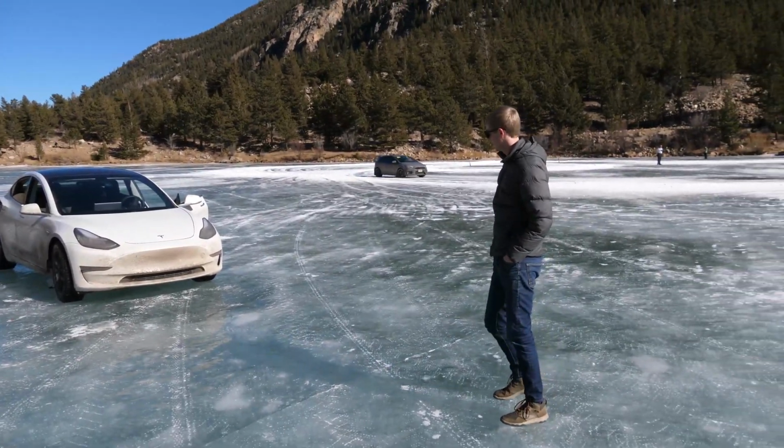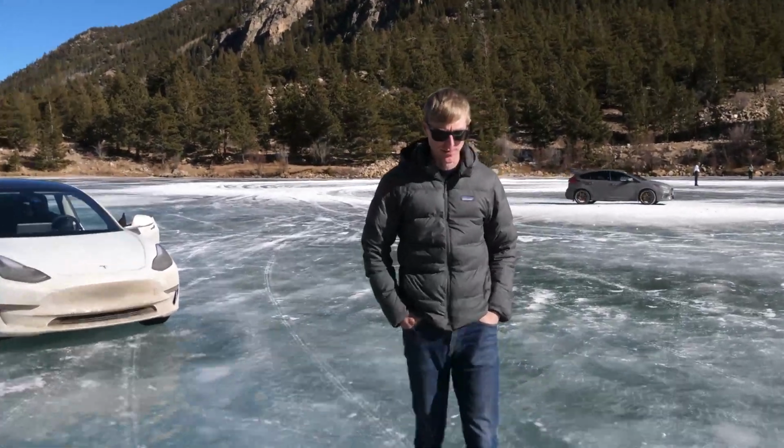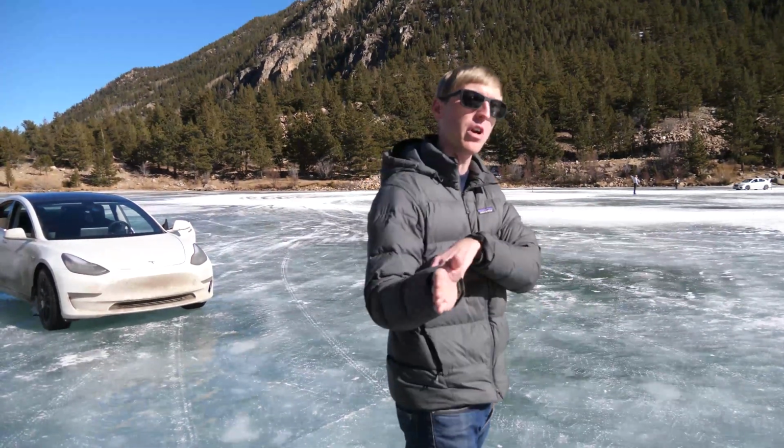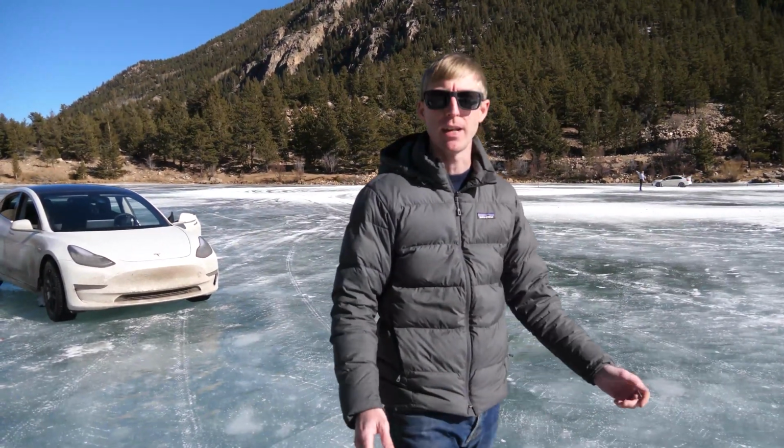All right, that looked like the best run so far, Drew. Yeah, that felt good. What were the settings? So went to 85-15 on the handling balance, which is actually the same thing I like to do for racing on dry pavement. So that's kind of funny to find out. Any further forward than that is too understeery, and any further back you just don't have enough control of the front motor when you're sideways to pull the front end forward. So yeah, 85-15 is my jam.